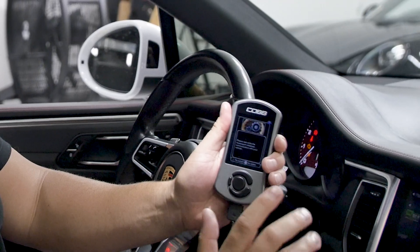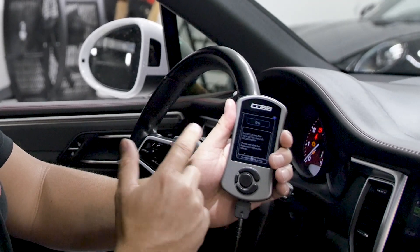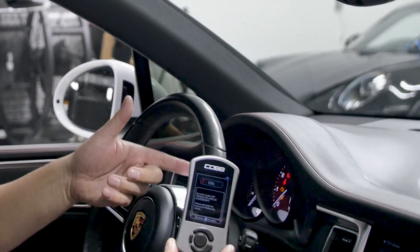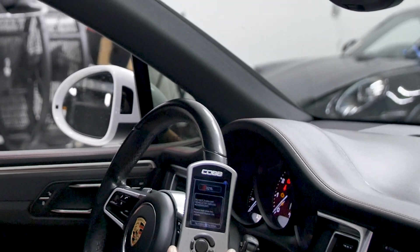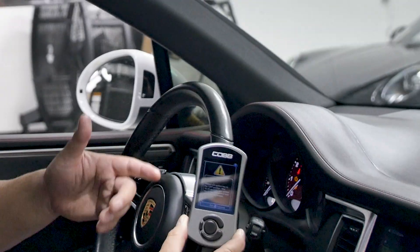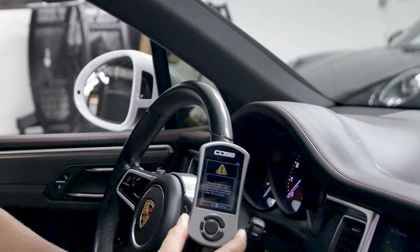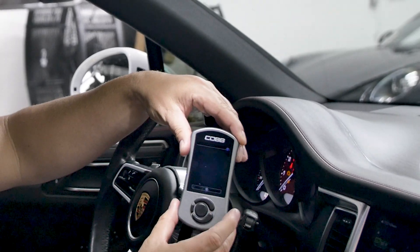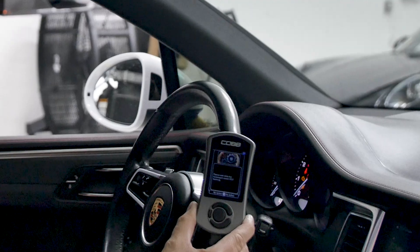But if you're below 11.8, I'd recommend using a battery tender or a charger to get your battery back up. You'll see here as it's running through the process — you'll have a status bar. Similar to when you're installing the Access Port, you will get some faults showing up in the dash. This is totally normal — it is now remapping part of the ECU with the new calibration. Now we're at 100%, it's resetting the ECU at the moment. It's going to ask you to turn the ignition to the off position for 10 to 15 seconds, so we'll turn the ignition off and count to 12. Then we'll cycle the ignition back on and hit the continue button, and you'll see it's finalizing everything with the installation and resetting all of the adaptations in the car.